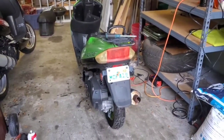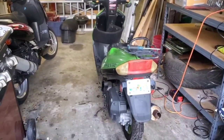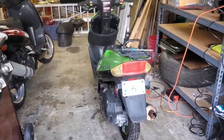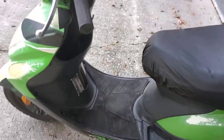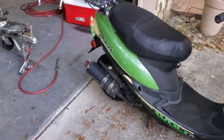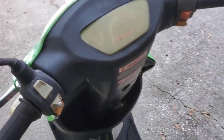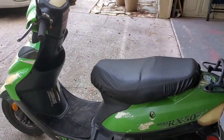She doesn't take any throttle yet because the valves are horribly out of whack. We're going to have to put them to .004 and .005 for intake and exhaust, and then it should start running again. After finishing it up we'll give it a paint job — hopefully it lasts 20,000 miles. We put a seat cover on it because that looked trashed. Paid 150 bucks for it and I'll charge a thousand dollars for whoever buys it. Give it an oil change now that all the parts have been replaced.